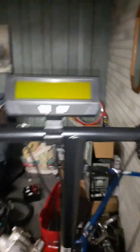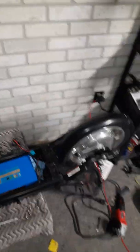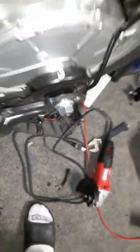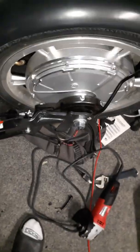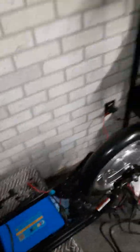This thing has other important applications you can use with your direct drive motor, like regenerative braking. I don't have the regenerative brake yet, but I will be ordering one — it's going to go on this side. So the scooter will have dual brakes: the traditional Razor band brake right here, which is quite effective, and on top of that I will have electronic regenerative braking, which will also feed power back into the battery. I'll be able to see all that on the Cycle Analyst display screen.